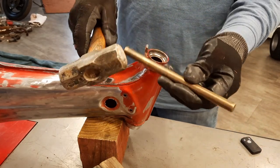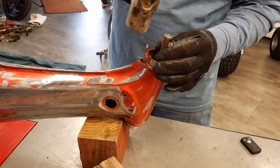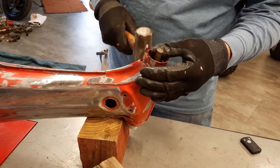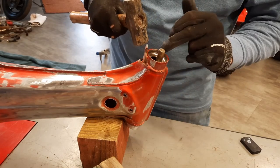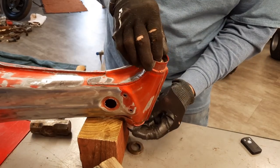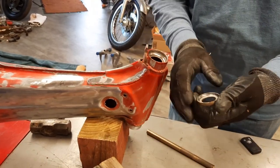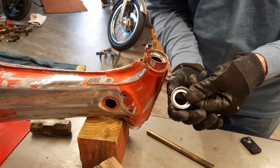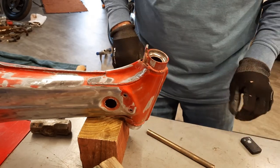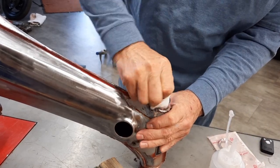What I've got is a hammer and a nice little brass drift - I've already popped it out. You just hold it against the race lip down here and out it comes. I didn't have to give it much with the hammer - it came right out. The smaller they are the easier they are to get out. You can see it's a little discolored where this is nice and shiny, so I'm going to replace it. I flipped it over and I'm going to clean it up a bit.